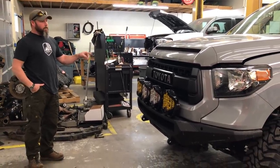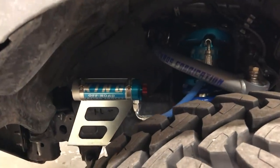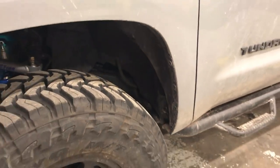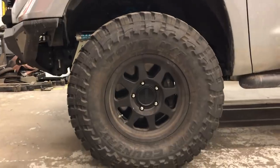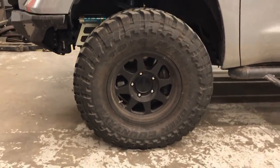Since it's so light in the front, we're running a 700-pound spring on the coilover with the Total Chaos upper control arm. With the proper amount of body trimming, the body mount chop the way we normally do it, boxing that in and addressing the pinch seam, we can clear a 35 12.50 17 real easy. This is the Toyo MT and the Method Race Wheels new 701 Trail Series — a really super clean look.